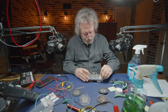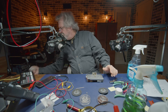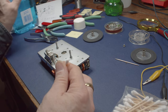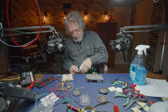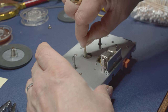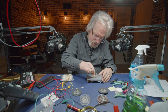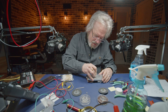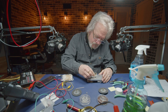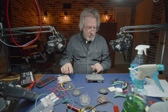Down inside the motor compartment, rather than try to get in there with a rag, we'll use a Q-tip and just clean the top of that motor. I'm using Simple Green for this because I don't want to use alcohol - I don't want to risk removing any lubricant on that motor shaft. Simple Green isn't going to attack it like alcohol would. But I will clean the shaft itself with alcohol, because it's been touching those rubber reel tables and I want it to have the right amount of friction.